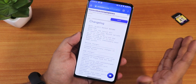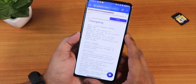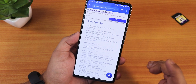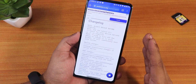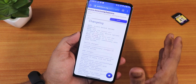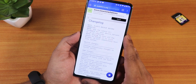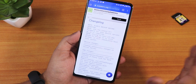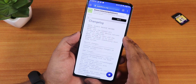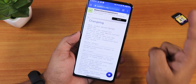Some people are still complaining about issues where the recovery gets stuck and you end up booting directly into fastboot. If you are still on the Android 10 vendor, the recovery might get stuck in fastboot. To fix that completely, you need to fastboot flash the latest Android 11-based MIUI, which is version 12.5.1. If you don't know how to do that, check out the card for the guide.